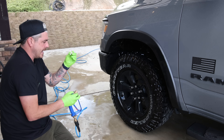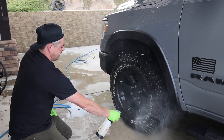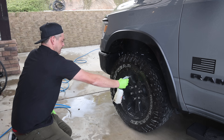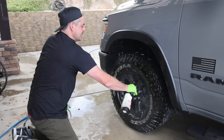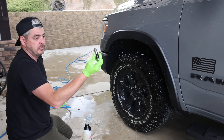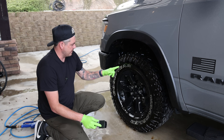I'm going to put the regular 40 degree nozzle back on. We're going to take the alkali wheel cleaner, apply it to the wheel and tire, and let it dwell for a few minutes. I really love this stuff for getting the blooming out of the tire — all that brown out of there. And because I want to try and clean the back of the wheel as well, I want to make sure I'm properly rinsing everything from the back of the spokes — that's where this little tool comes in.